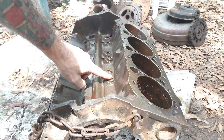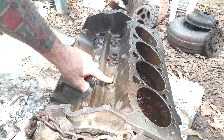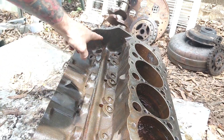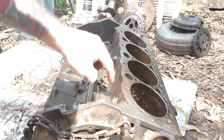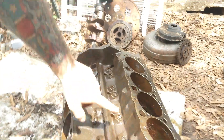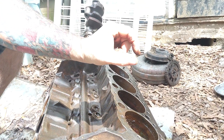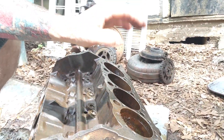These are hydraulic lifters — they have to fill up with oil. What these do is they work off the camshaft. The camshaft's got a bunch of different lobes — the lifters sit on those lobes, and they all come up at different times. They'll come up and take a pushrod — a pushrod goes through here up to here onto a rocker arm, so it'll move the rocker arm. So if you're ticking a lot, you think you got a lifter going bad. Well, they're not pumping up, and when they don't pump up, what you hear is the pushrod has got a gap in between it and the rocker arm. So it's just sitting there hammering — sounds like a leprechaun with a ball peen hammer inside your engine.